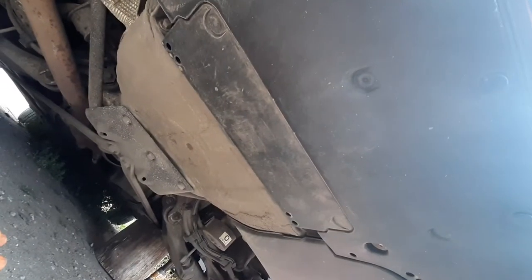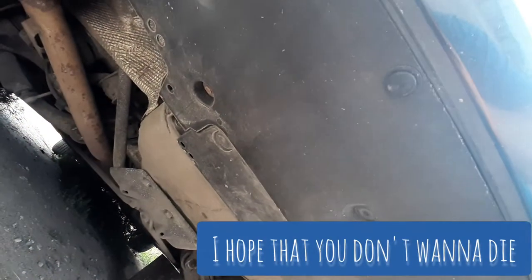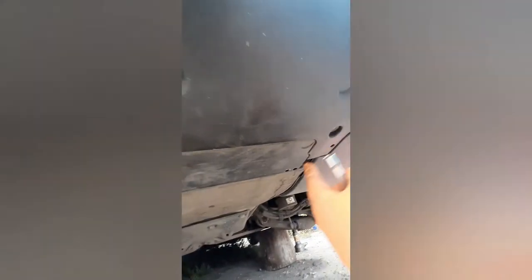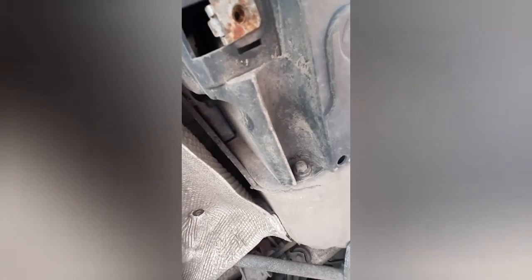If you want to lay down under the rear of the car, make sure that your car is lifted properly. Now we need to remove that cover from the rear bumper — there are two 8mm screws and some plastic pins. Most BMW engineers want to be sure that no one could steal your compressor, so you need to remove one more cover with two screws — 10mm.